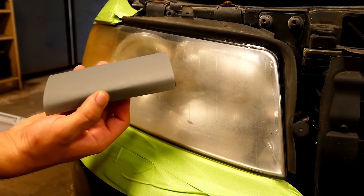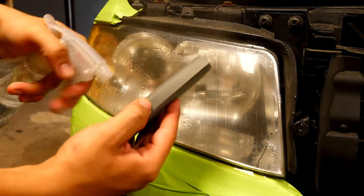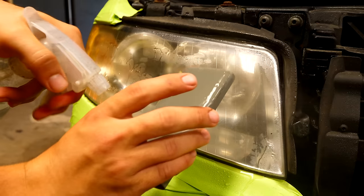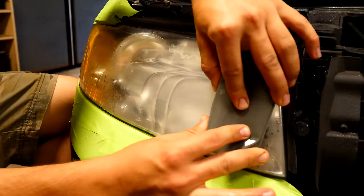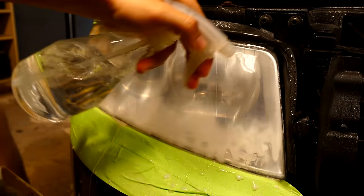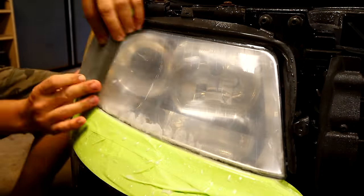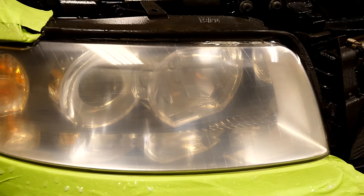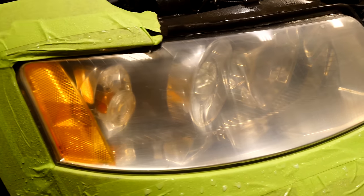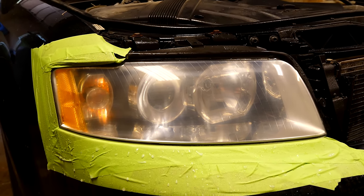After that, we can begin the headlight restoration procedure by using some 1500 grit sandpaper and a foam sanding block. We'll be using water as a lubricant during this step so the oxidized plastic will stay contained in the water and not be introduced into the air as dust. It's crazy how gross the water will become. You're going to want to do overlapping passes with the sanding block so that you get every square inch of the headlight cleaned up. Do this until you don't see any more yellow haze, but you'll start to see some scratches from the sandpaper. If you do see any more haze, wet sand the lens even more until it's perfectly uniform. Once you're done, you should have a finish and a result that looks like this.